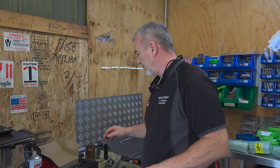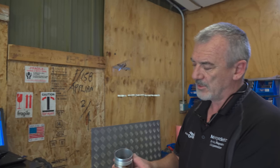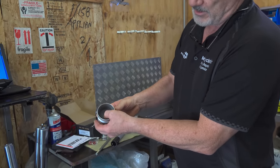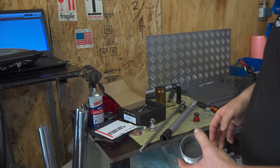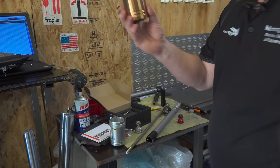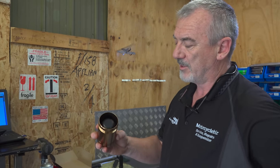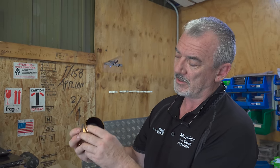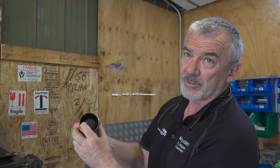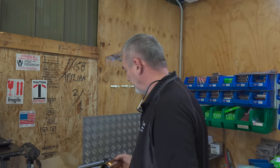Then when we get your shock out, we're going to take this off the shock, which is the piston. What you'll notice is it takes quite a bit of force to get that piston to start moving. We're going to replace it with a bladder. And the bladder is going to be suspended in the middle of that with nitrogen on this side, oil on this side. And as soon as any force is applied to it, the bladder flexes. Wow. So it reduces the stiction friction.